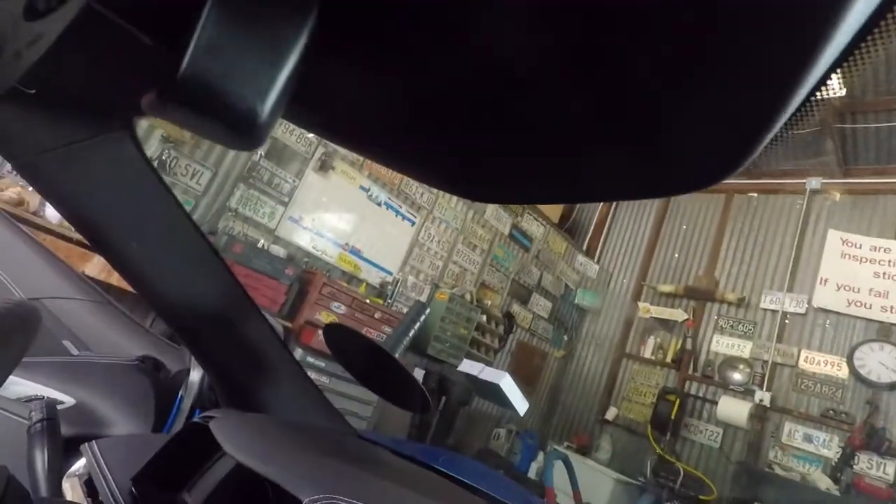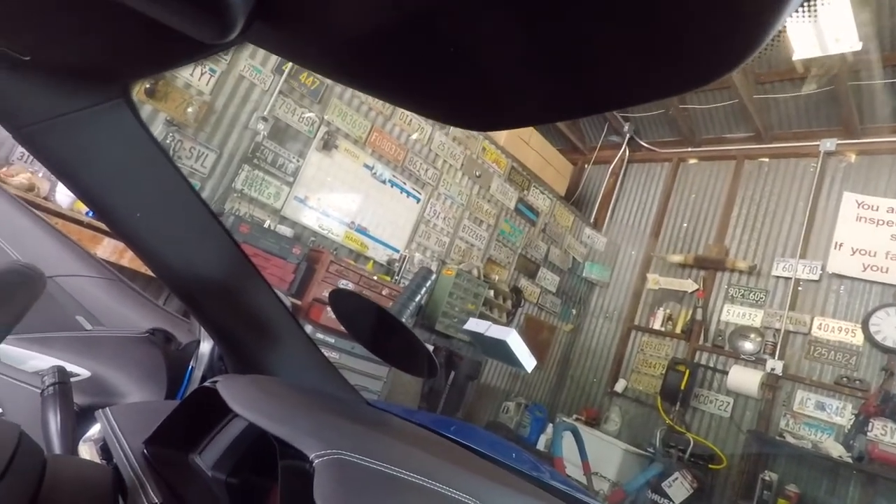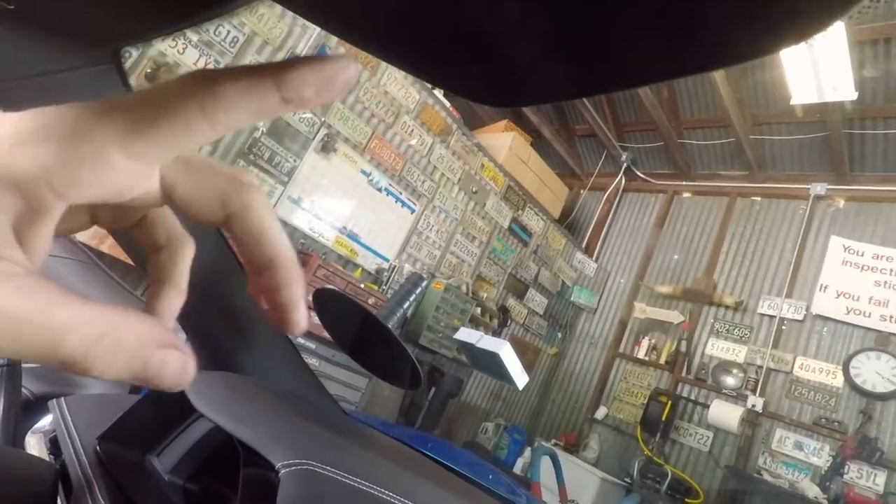The plastic cover is kind of hard on this car. It's got two dowel pins that go into the headliner at the corners at the glass, and then the top clips go into the headliner. The problem is the headliner just wants to flex and there's no way to hold it down while you push that up. So I just pushed right on the clip, pretty hard, so it would seat all the way back into the headliner. But other than that it's not too bad — you just can't be scared to push on it.